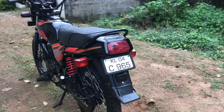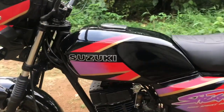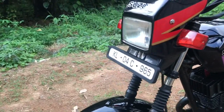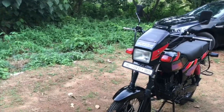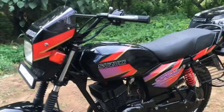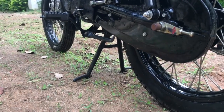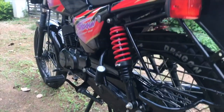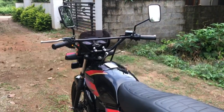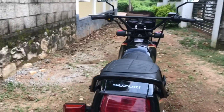If you buy parts individually rather than a complete set on OLX, it becomes cheaper. For the Apache setup, you first need a Fiero F2 hub. If you're fitting it on an RX or a Shogun, you need to grind the worm down by about two millimeters before it will fit. The Apache mudguard doesn't fit directly because the T-stem distance is a little low — you'll need to cut it. I haven't tried an RX mudguard on this but I've seen others fitting it on their RXs, so it's likely to work.